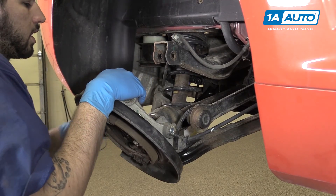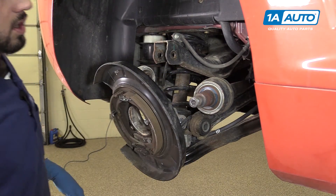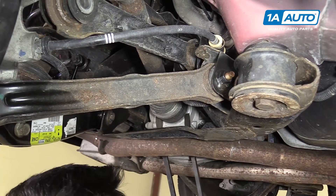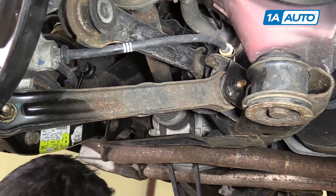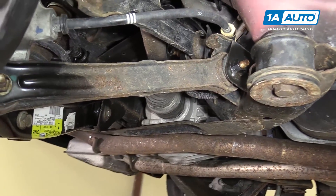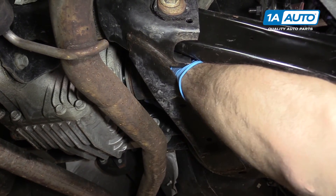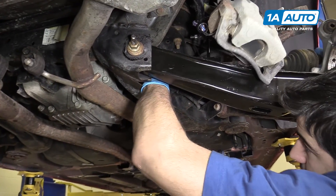Pull down on the top of the steering knuckle. You should be able to work the CV axle out and set it off to the side. If you have a CV axle puller, that's usually the best way to do this. But without the tool, you can get pry bars evenly on each side of the joint — usually just a little bit of pressure will pop it out of socket. We do have a drain bucket set up underneath the differential because sometimes it will leak just a little bit of fluid out of the seal. Once you get that end popped out, you should be able to completely remove your axle from the vehicle.